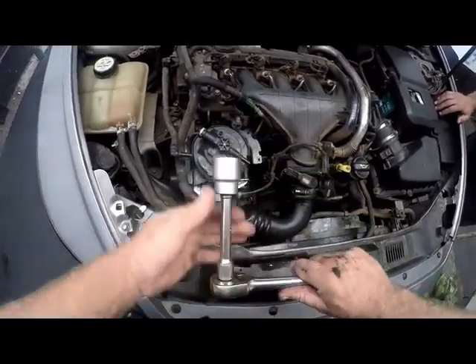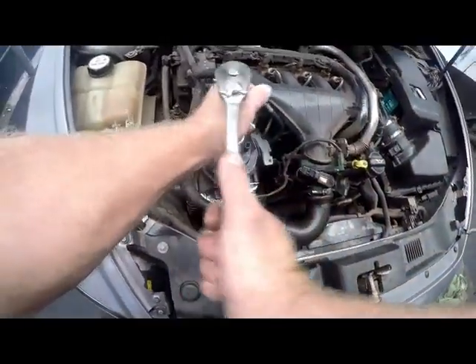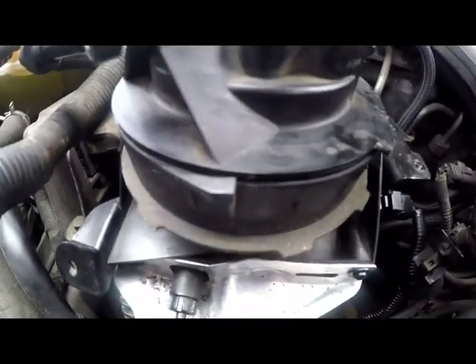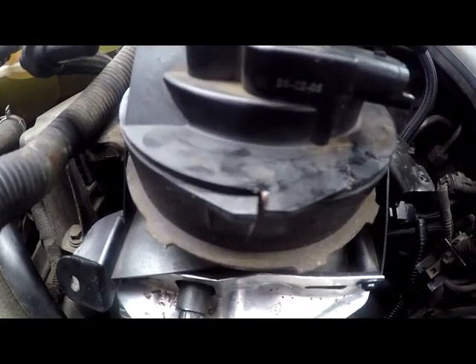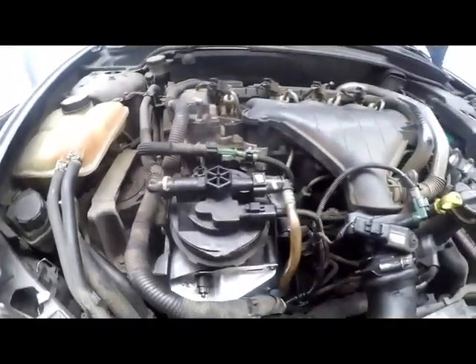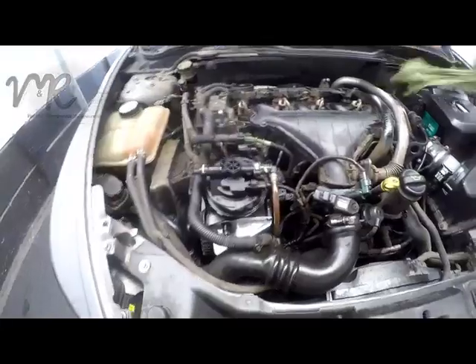Use a size 27 socket, half-inch drive, short extension and a ratchet. Tighten it up — you'll see that it has got a stop. As you get close to the stop, you can see the two joins coming together, that gap closing up until the two are touching against each other. That is it — you can't go further than that. Then take the outlet and push it on — you'll hear the click. Take the inlet and click it in as well. Wipe up all your spills as you go along.